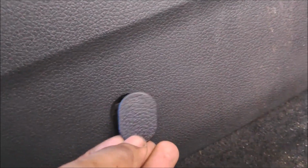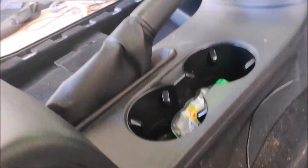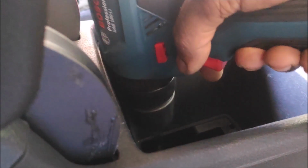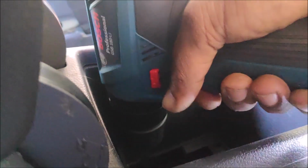Okay, on this car we never actually remove the center console, but we remove the screw mountings just to have a little bit of play for us to remove the carpet without removing the center console. Whenever you are learning a new car, don't go extreme, don't remove everything. It's easy to remove, trust me. It's just a few screws there, here, there, okay, everything is out soon.